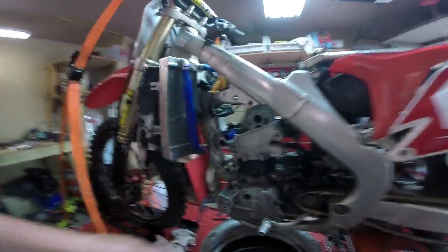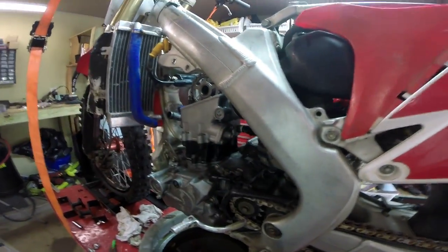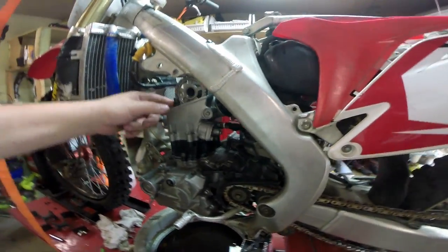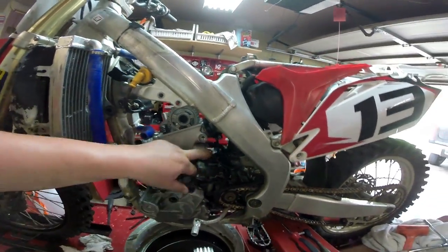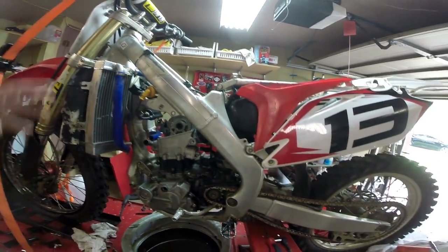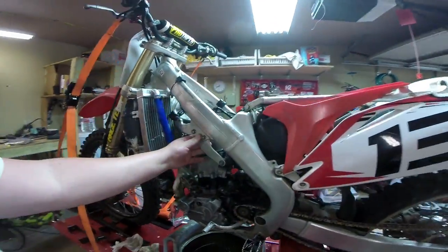After this point I think we can actually kick it over just by hand and make sure nothing binds and everything seems to work. The timing chain tensioner is in — basically you want to untension it, put it in there, put the bolts down, and then release it and it'll auto-tension the chain. You can see it's quite taut but still a little bit of give — that's exactly what it's supposed to do. It can be kind of a pain in the butt to get in there. The next thing we're going to do is adjust this and tighten the intake, then put the cover on the valves. Everything back together, everything tightened up.